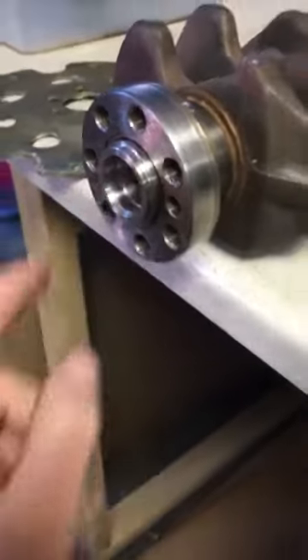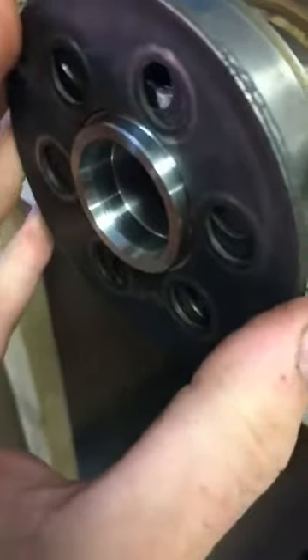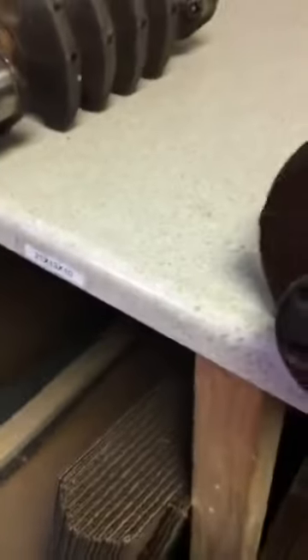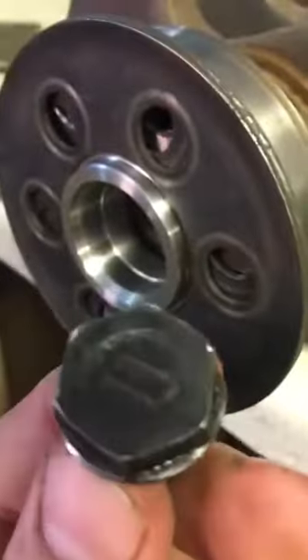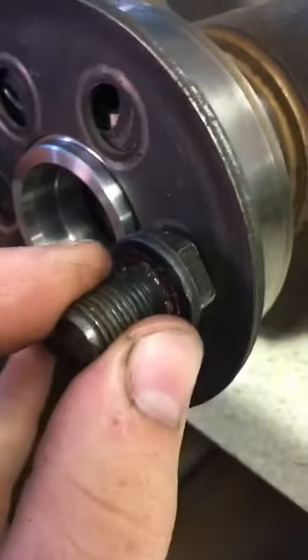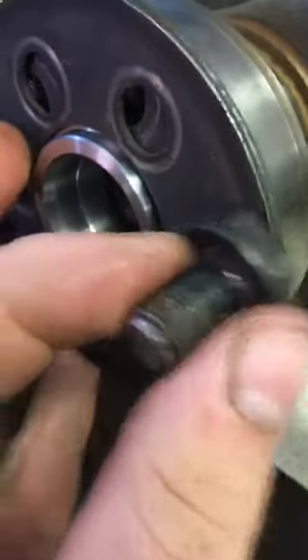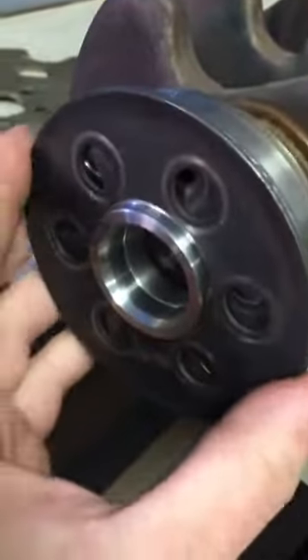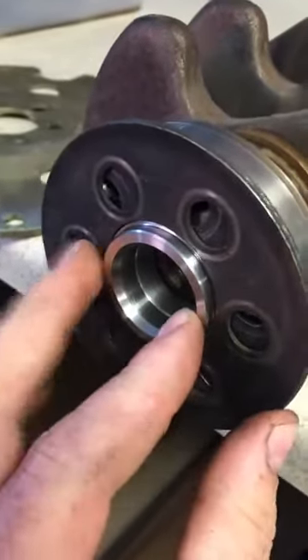The main reason they changed that step back is because the depth of the hole on the crank is different. When you're using OEM parts, if you don't have the proper step back in there, your big 19-millimeter hardware is going to be hard to get a socket on because you don't have that step back there. So Paul designed this to work with both and have clearance for OEM and aftermarket applications.